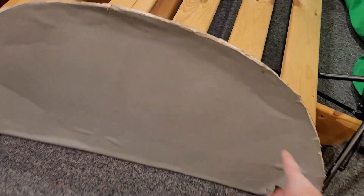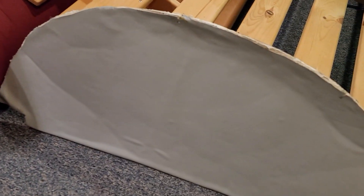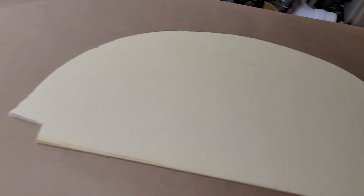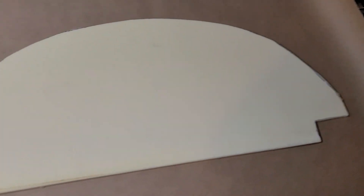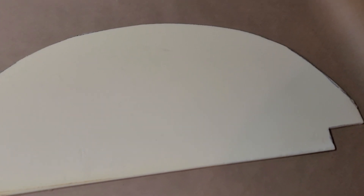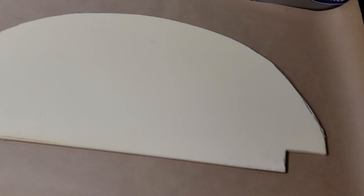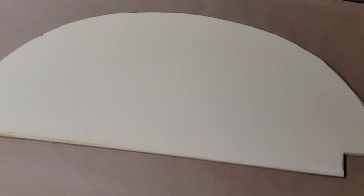So I'm going to try and save the leather — see if I can peel it off in one piece. If not, I'll replace it. I've traced this out and cut a new piece of foam to match that size. I've also cut some fiberglass — I'm going to put a couple of layers on either side of this foam to make it reasonably sturdy, lightweight, and strong. Then we'll see if we can get that leather back on there and get it back up inside the airplane.